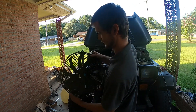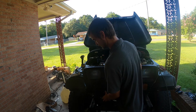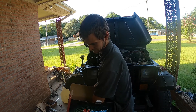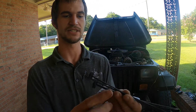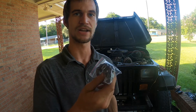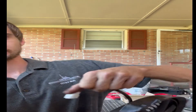The fan is a 12-volt 120-watt fan. I'm going to use it as a pull style — it's going to pull through the radiator. The kit comes with all the mounting supplies you need. It has little tabs that you push through the fins of the radiator, basically like a fancy zip tie. You put little locking pieces on the back, and then there are little legs that go on the shroud itself.